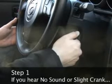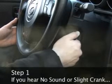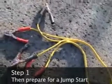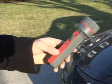If you hear no sound at all when you turn the key, or if the engine cranks slowly and the accessories do not work, then you have a dead or low battery and it's time to break out the jumper cables. You'll need a flashlight if it's dark outside.